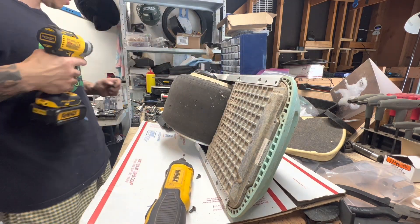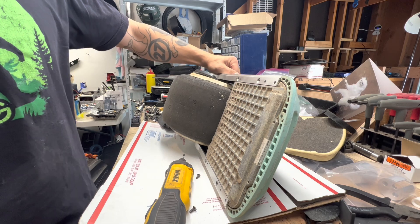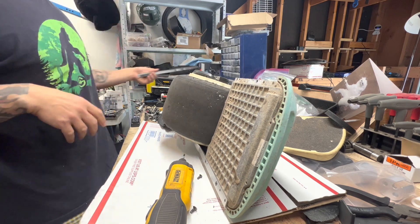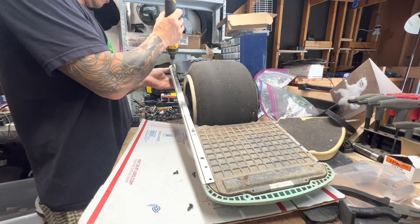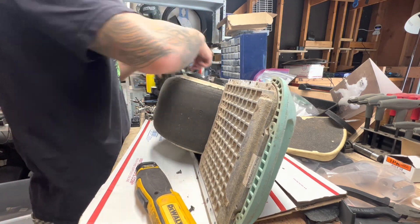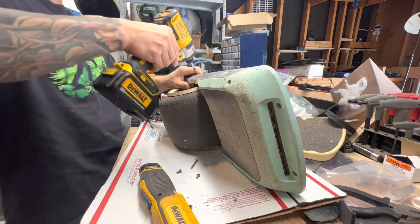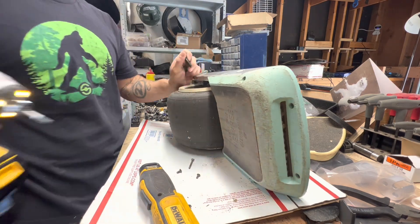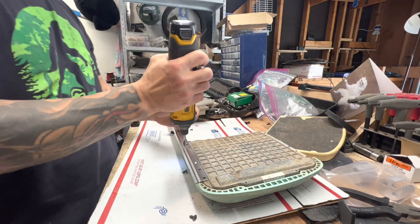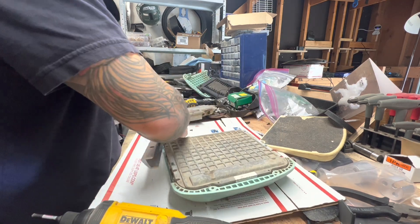I do the removal of one whole single side of a rail, and then the motor out of the middle of that — on all of the Pint models, whether it's the Pint, the Pint X, or even the GT, which is basically just a large pint. I go ahead and take the whole single rail off because there's no room underneath in that little compartment to move that cable around very well. If you destroy that cable or ruin any of the pins on your controller side, you are screwed. The best thing to do is take the tire off because then you have enough room to work, and all you've got to do is take the other rail off. It's a lot easier — a couple extra steps, but it's a lot easier to put the cable back in at the end of it.